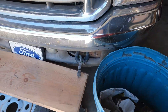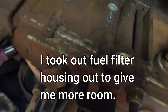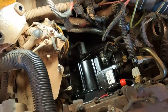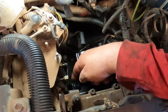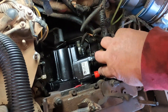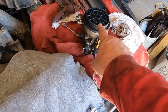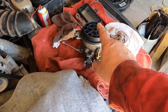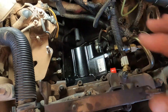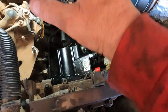Let me show you where the pump's going to go. I'll bring you upside down - and there you can see the hole. There it is, we've got it installed. The two 10 millimeter head bolts are torqued at 18 foot pounds. I've got one fuel line on right here, going to take that cap off and put this other line on. I've already got my fuel filter housing - I installed a new fuel filter while I was at it. I have new fuel O-rings, four of them, so I got them all on. Now we just need to sneak this thing in, get that line on, then get all those lines attached and attach it to the engine.